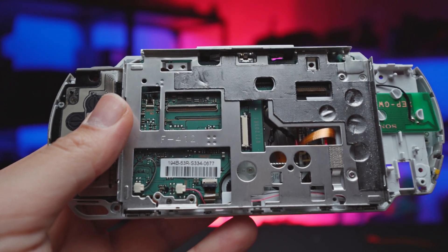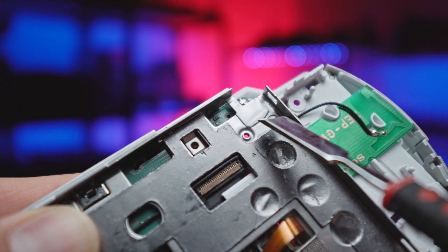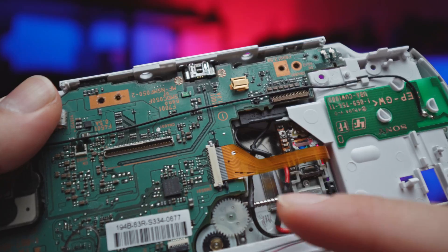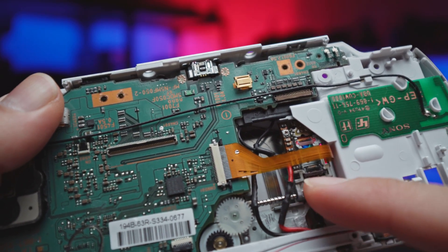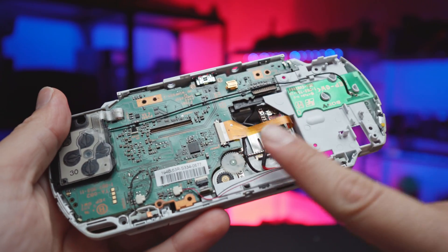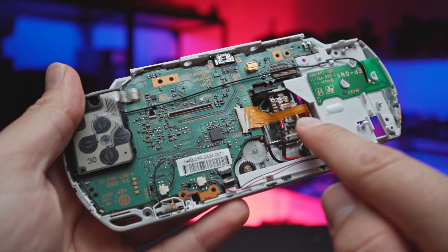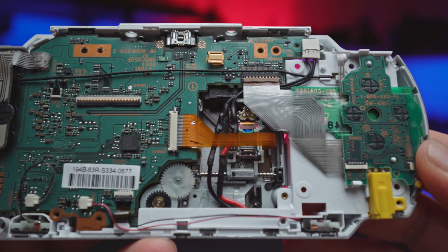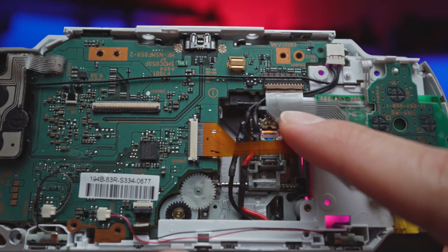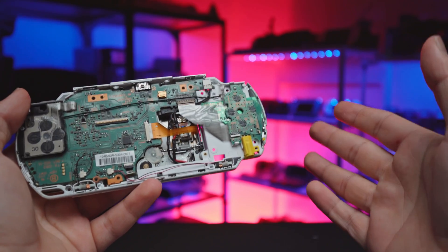To make sure you have a proper installation, there are two ways to tell. One is that the plastic pin piece can sit comfortably through the opening of the mid frame, ensuring the frame sits properly without the wires interfering with the UMD drive. If you don't care about the UMD you can leave it as is, otherwise make sure the wires hover ever so slightly above it so the sensor moving back and forth has nothing interfering with it. Here's one last look at routing: first the wi-fi cable, followed by the charging cable, then overlay the side PCB on top.